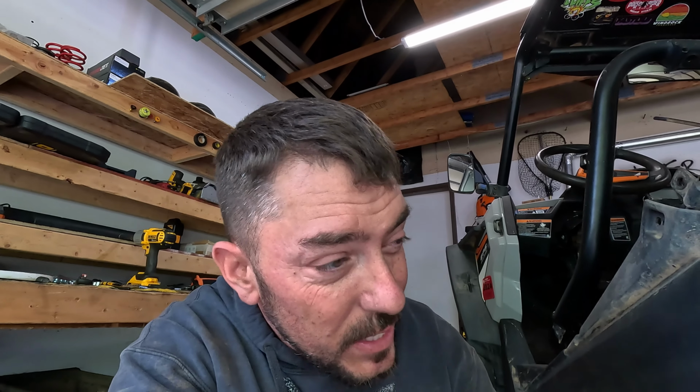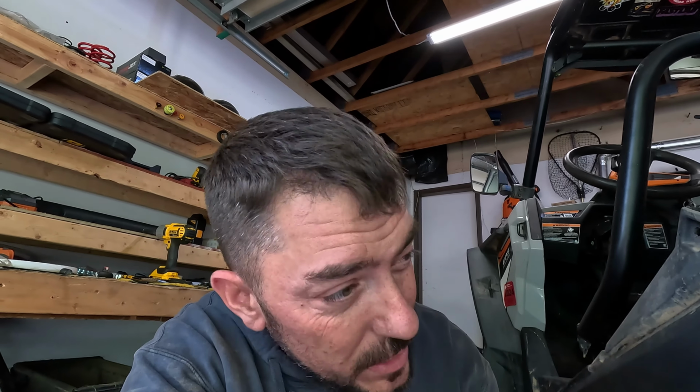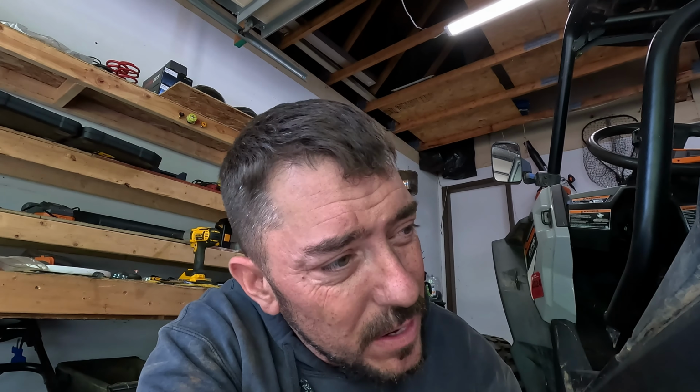With this sitting in the bottom of the pan in those little divots, get everything up underneath that motor without messing up not only your silicone so it don't leak, but then make sure that you get this screen to seat back up on your oil pickup like it's supposed to. And I feel it's going to be one of those, if I have to force it up in there, it's not right. But that's pretty important. We got to make sure we get all that stuff lined up, because last thing, I don't want to do this again. We're looking to do this right the first time and go from there.